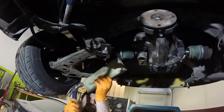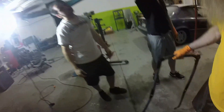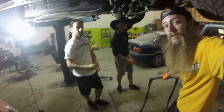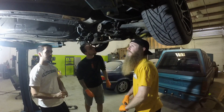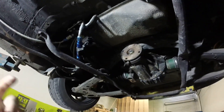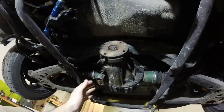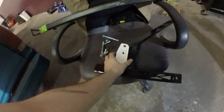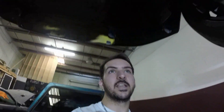This brace is really nice for rigidity — you need these little tiny mounting holes in the front body, so if your Miata didn't come with them as an NA8 and you get a brace like that, you're good. As I said earlier, you have to get rid of your power plant frame when you do this swap. The power plant frame mounts right here, and in order to mount your diff without just having those two mounting spots, you have to buy this brace from K-Miata. It does not come with the kit — don't know why — but if you want to do this swap you pretty much have to get that brace or make your own.